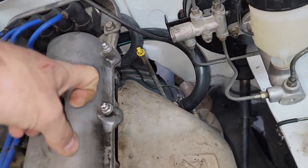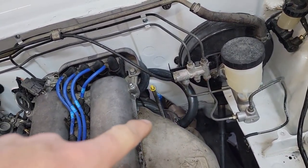I added the heater core — let me flip this around. That 90-degree fitting goes straight out of the firewall, and that tube there is from a Honda. It does a nice 180 and that's just normal 5/8 heater hose with a nice sweeping bend, so it made the bend with no kinks. Then I added a 90 into the firewall as I just showed you and connected to the heater hose.